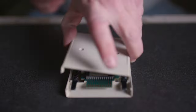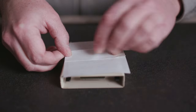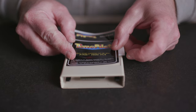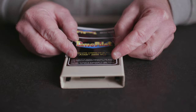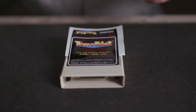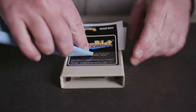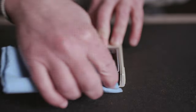After making sure my cartridge was totally clean, I dried it off, made sure it was at room temperature, made sure the label was at room temperature, everything clean and ready to go. I got a little rag and started applying the label. When you apply any label to a video game — heck, when you apply any label to anything — you want to get it on straight. So you start by peeling the backing off the label just a little bit. You line up two corners and make sure it's as straight as possible. The tricky part is you can fool yourself. A small variance here is going to have an exponential effect on the other end. If you're a little off square at the top and you don't notice, by the time you finish applying the label, the bottom's going to be way off. After I was sure, I tamped down the label and used my rag moving side to side to push out any air bubbles. Then I pulled a little bit more of the label backing off and adhered it to the cartridge by moving my rag left and right, continuing in that manner — reveal a little bit more, push a little more down — until I got to the very bottom, wrapped the end around, and luckily it fit perfectly.